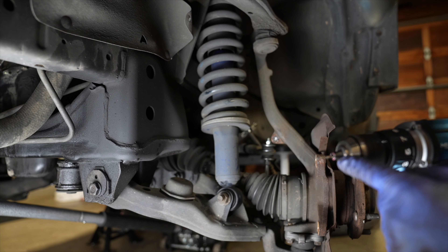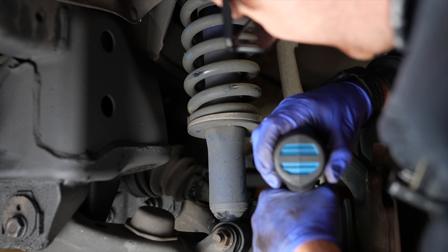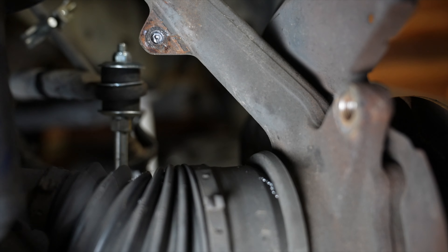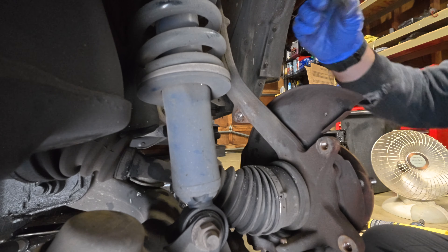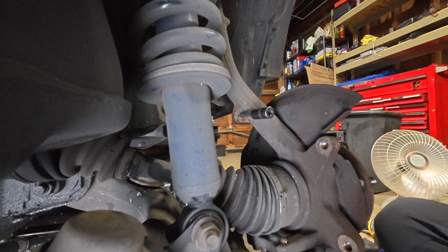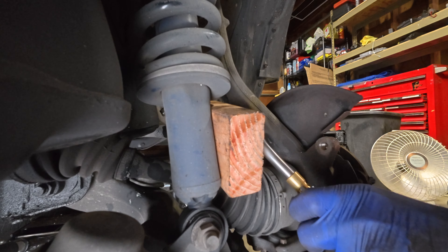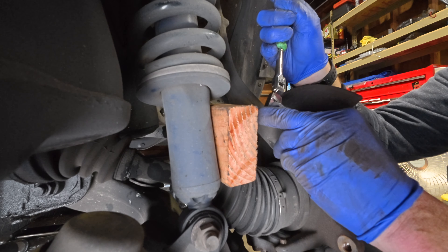I like to put the drill bit as far into the drill as I can, because if it breaks off you're going to have a whole bunch more problems. After a nice pilot hole is drilled with some depth, you can try the screw extractor — but I'm not a huge fan of these because ninety percent of the time they don't work. If the screw extractor breaks off inside the spindle you are absolutely screwed because it is made of hardened steel. I gave it a little extra love with the torch and a couple extra center punches, but the only thing spinning is not the bolt.